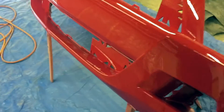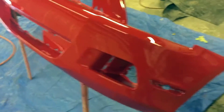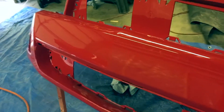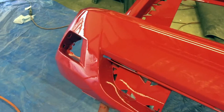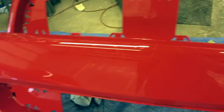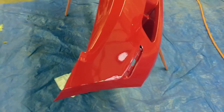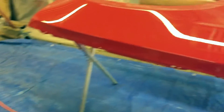I had a couple rough areas after the second coat so I went ahead and did a third coat — and still didn't get any runs. It's got some dust nibs in it just like it always does, so I'll sand and buff that, but I do not have to buff any runs. Hopefully we can buff this thing without any more burn-through or sand-through and get it put on the car this week.